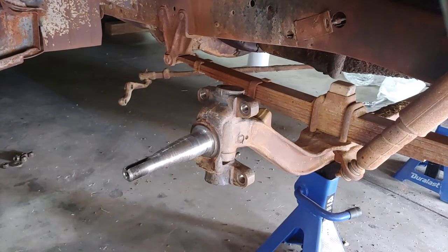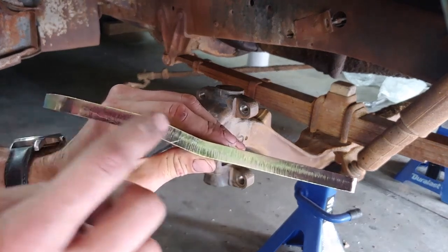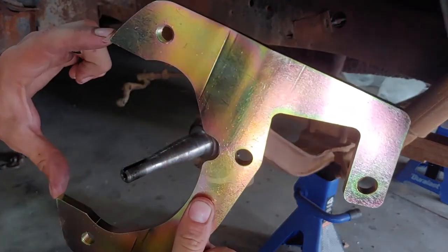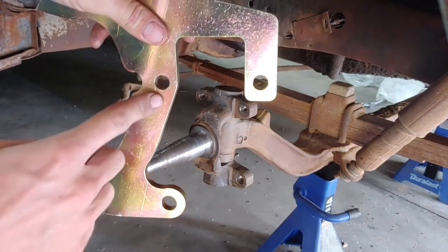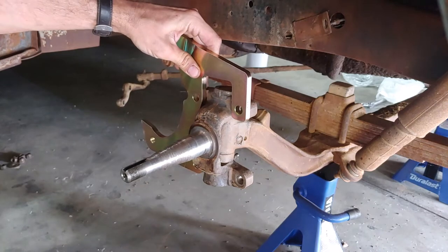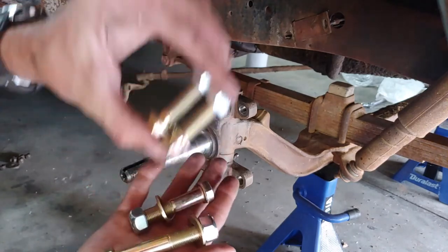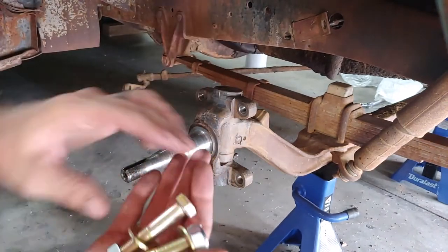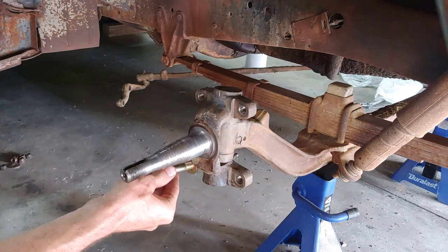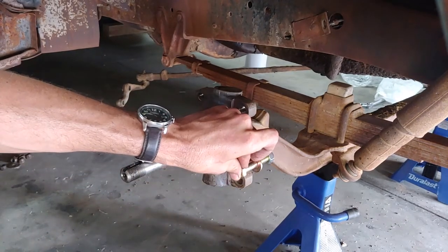Next, install the caliper bracket. To know which side is left or right, you can see there's a slight jog in the bracket — the jog goes toward the inside, and the hole for the caliper goes to the back. Instead of the four mounting holes like the drums, this is just going to have three. CPP provides the hardware: the two short smaller bolts are for the top two holes, the long bolt goes in the back through the caliper bracket, and the other goes through the spindle and steering knuckle.